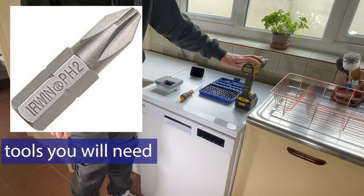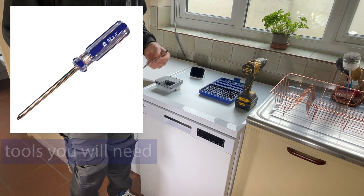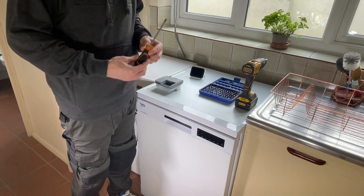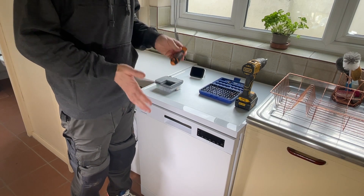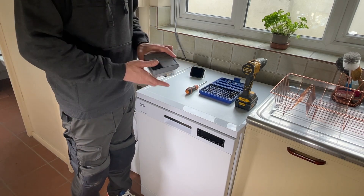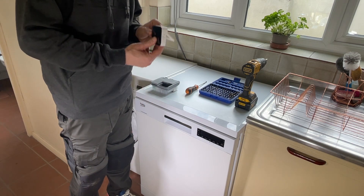The tools you're going to need are either a drill driver with a Phillips number two bit, or just a regular Phillips number two screwdriver. The screwdriver gives you a little bit more feel — I generally favor it, certainly for putting screws in when you're using wooden doors on the front for integrated appliances. You'll also need a replacement part; I'll put a link in the description for my specific model.